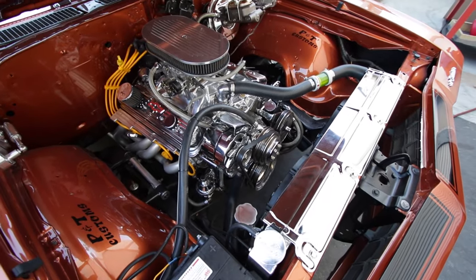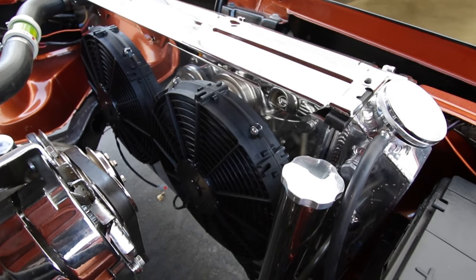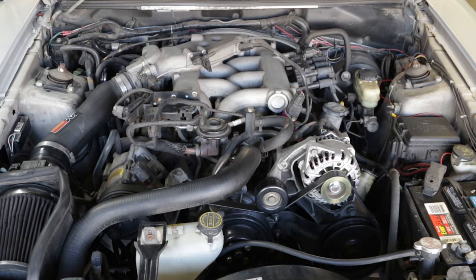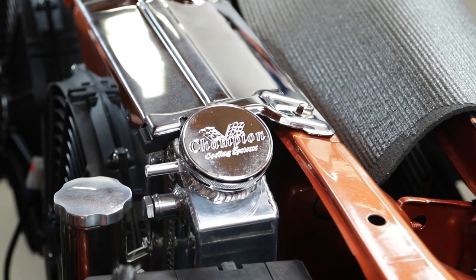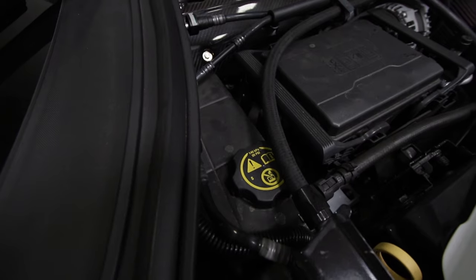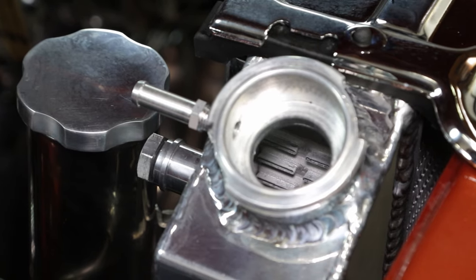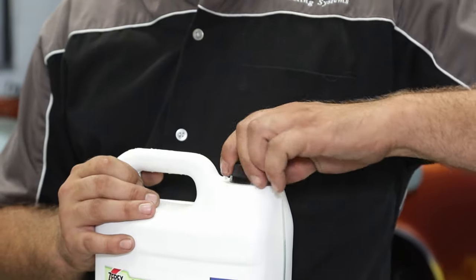With your new Champion Cooling System's aluminum high-performance radiator installed, it's time to add coolant and purge trapped air from the system. Factory cooling systems are always designed with some sort of fitting at the highest point in the passages when the vehicle is on level ground. Often, this is the radiator cap, but it may also be a pressure relief cap on a remote reservoir or a separate fitting. The reason for this design is to allow trapped air to be purged from the system.